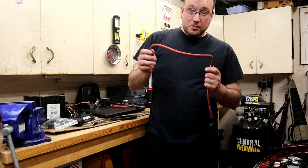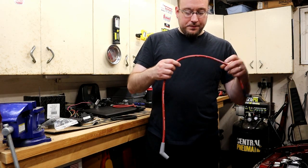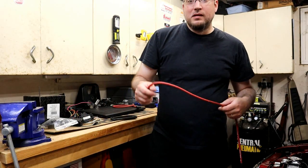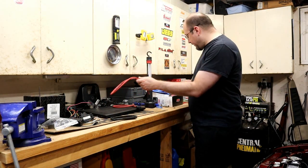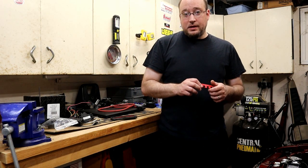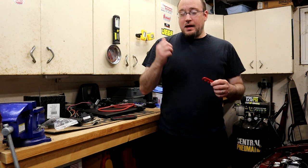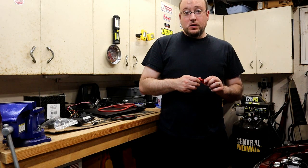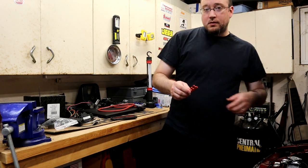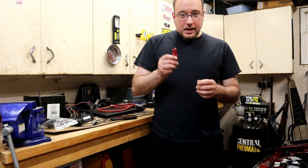And that was one issue, but that's not the only one. Number four wire — look at that. This one was starting to melt as well. I have standard motorsport wire holders, and none of my wires were laying directly on the headers, though they may have touched at some point wiggling around in there. But my car is turbocharged, and having this set of wires on there, I was able to make them work — but unfortunately, that was causing my ignition cutout issue. The heat was actually melting the holders too.